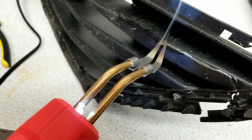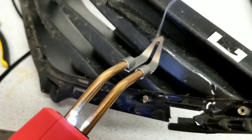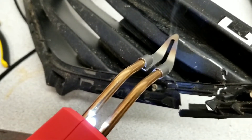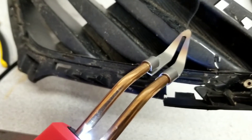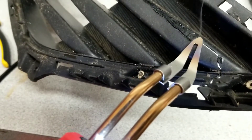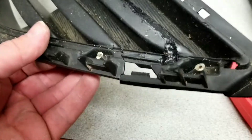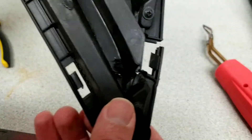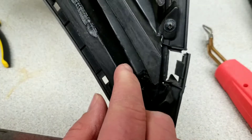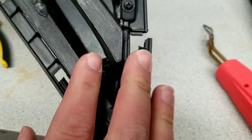If you're going to use this on a bumper or fenders that are plastic, you're going to be able to go back through and do some Bondo to really finish off the work. This is more of just a mechanical fix to make sure everything is not cracking when it's put back on a car. Now we have the front all troweled across, and on the back we have the staple holding everything together — before you could see daylight all the way through the crack, and you can't see that anymore.